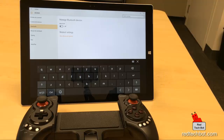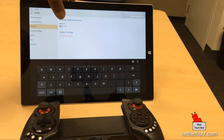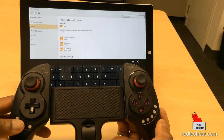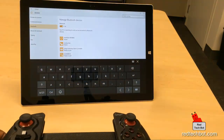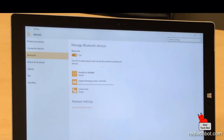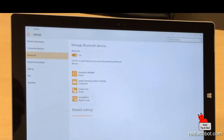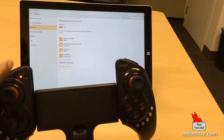For this demo I'm using keyboard mode — to recap, keyboard mode is when you hold down the A button and the home key to pair with your tablet. I'll turn on Bluetooth on the device now. Then I press the home and A key down at the same time, and as you can see it's flashing very quickly. The IPEGA extending game controller comes up on the tablet saying 'ready to pair,' so I tap that and select pair. It takes up to 30 seconds — it's paired, the driver is installed, it says connected, and the light is solid orange. We're now paired in keyboard mode.